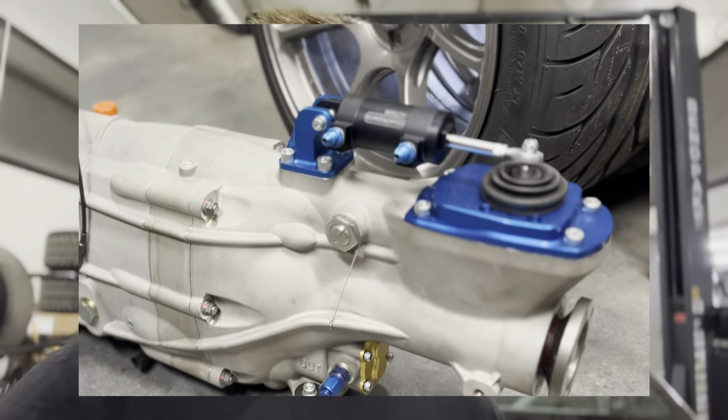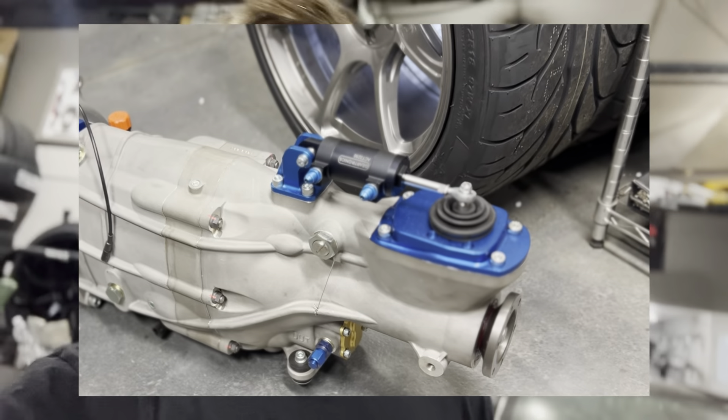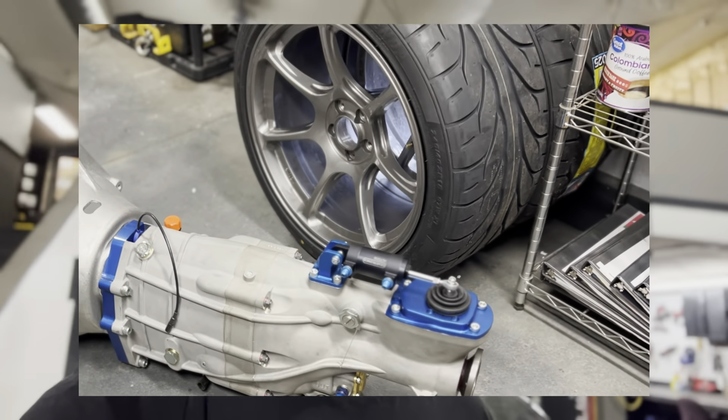It's missing a shift lever because this trans is air-shift operated. It's got its own little air compressor, a little air tank, and two solenoids that control the air going to the little air valve on the shifter. There are two ports — one for an upshift, one for a downshift. It gets its air supply through the solenoids, which are controlled through the computer, and that controls the shifts.